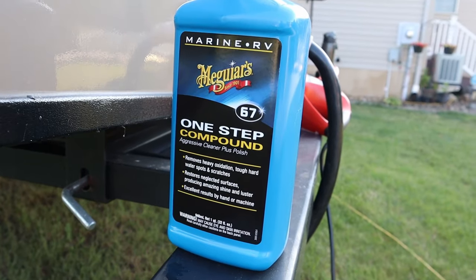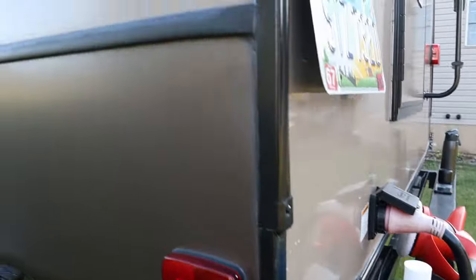The other change I made was finding a product designed for restoring finishes that also leaves a polish — a one-step, two-in-one product instead of using a cutting product to remove oxidation and then a secondary product to polish. That's the Meguiar's One Step — I'll put a link in the description. Using that with the wool pad and the six-inch Black & Decker random orbital buffer made a big difference — I'd say 50 to 60 percent better — but it still didn't get it back to that original glossy look on the other side of the camper.